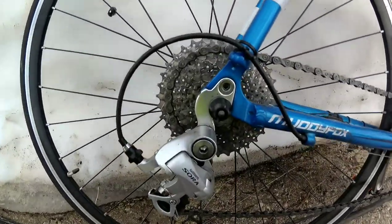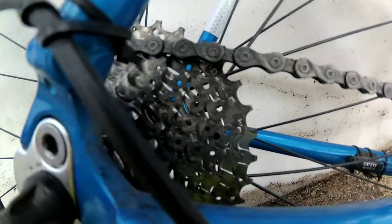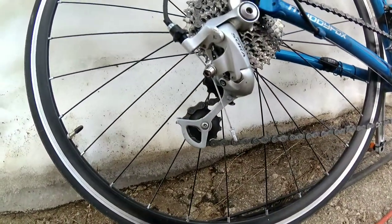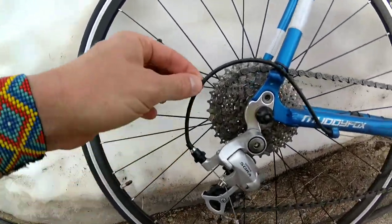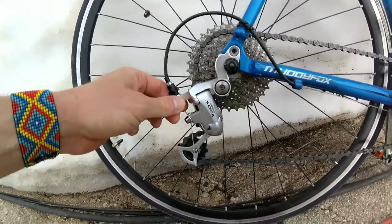This is the bare minimum you need to climb steep hills — it's a 34 cassette on a Shimano derailleur. It's possible. You can do it either by shortening the cable tube or putting a zip tie and pulling it a bit backwards. You're gonna need a longer chain to fit the big cog.